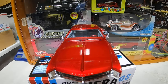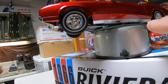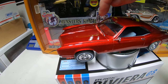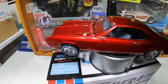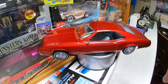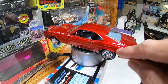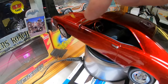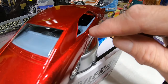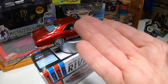So the rear end, this is good, got up tight, but I think part of the problem, it looked to me like possibly the dashboard is hitting the windshield, like maybe the windshield is down a little too far, and of course it's fit right on the pins where it's supposed to be. But I think that's keeping the interior bucket, well, it's really not a bucket because the interior is all separate components. But as you can see in the window frame right there, it's a little lower in the front area than it is in the back.